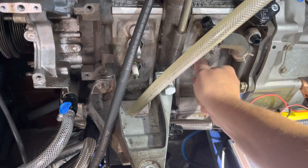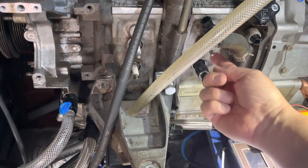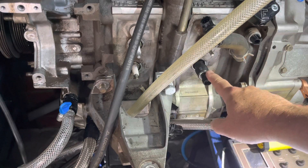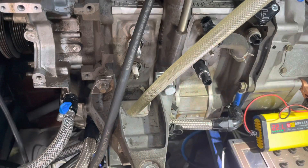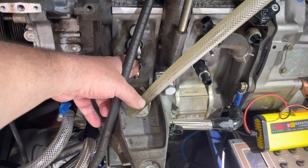Obviously, if you pulled out the trailing spark plug when doing a test, you're going to get zero compression because it'll have a leak via that open spark plug. The only time you would take out a spark plug on the opposite housing is if you've got low crank speed because your starter motor's not great — you could pull your leading out on the other side to allow it to crank faster.